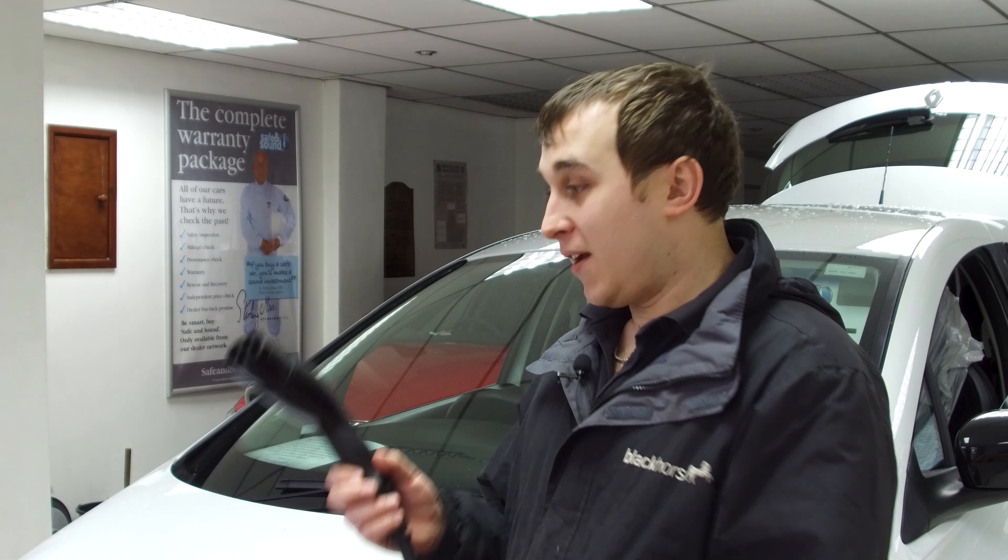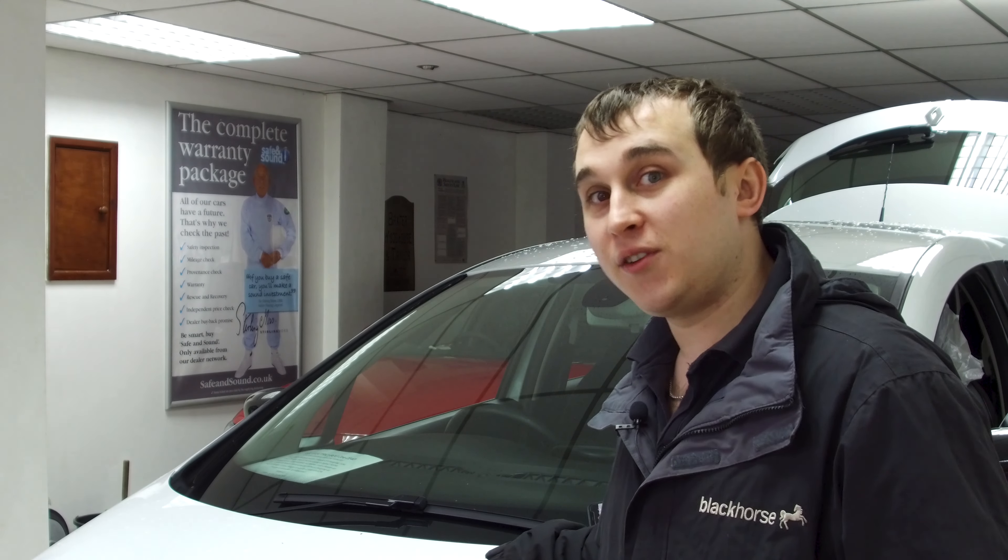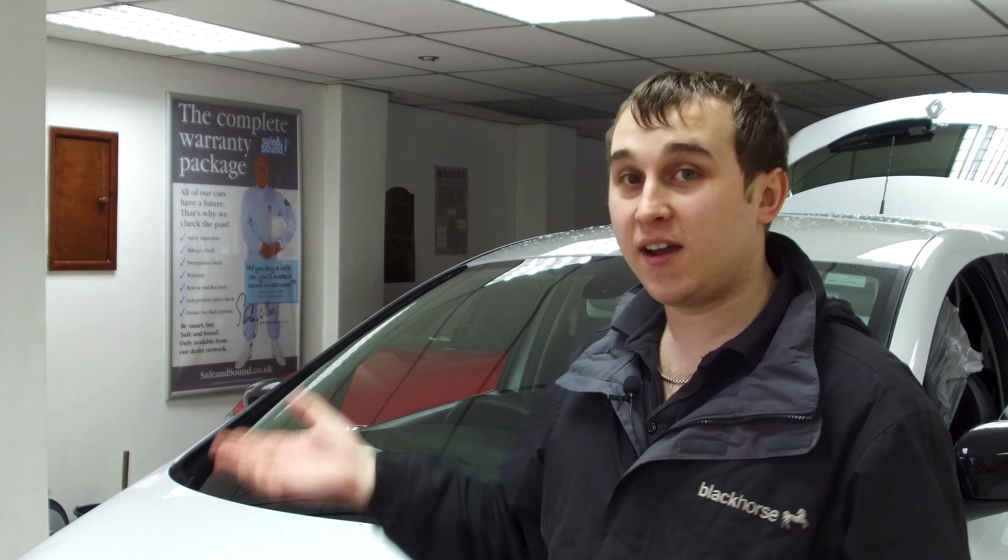Some cars are capable of more, especially a lot of the new ones coming out this year. My favourite, the Renault Zoe, can do up to 43 kilowatts using three-phase, and some are capable of 22 kilowatts three-phase — still much higher on AC than other manufacturers. For a home charger, my recommendation is to get a 7 kilowatt single-phase charger. At my work property, I had a three-phase charger installed capable of 22 kilowatts — the Zoe charges at 22 kilowatts on it, while my BMW is only capable of 11 kilowatts three-phase. Check your car's specs or the EV database linked in the description to see what your car charges at.